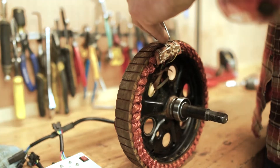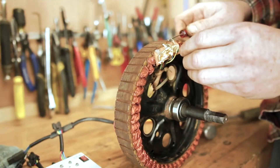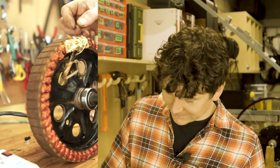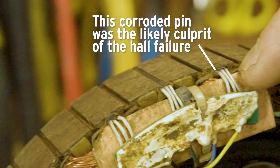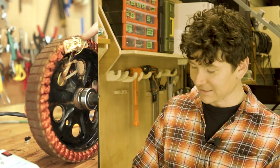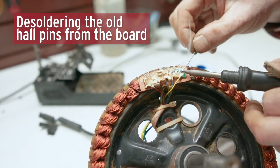That's not to say the hall sensor itself is damaged — the silicon chip is probably fine. Usually what happens is the water conducts electricity and corrodes the positive pins, and that corrosion cuts right through the metal until you no longer have a complete metal joint somewhere in the wiring. So technically the hall sensor is probably okay, but the pin going into it is corroded off. We did an in-depth video on hall sensor replacement previously, so we'll just zip through it and hopefully after that we'll be able to put this beast back together. After punching out the hall chip, one of the three hall wires just completely fell off the PCB — so the actual break in contact was that lead wire. Had I known that in advance I could have just soldered a little bridge, but now we're just going to plop in a new one.